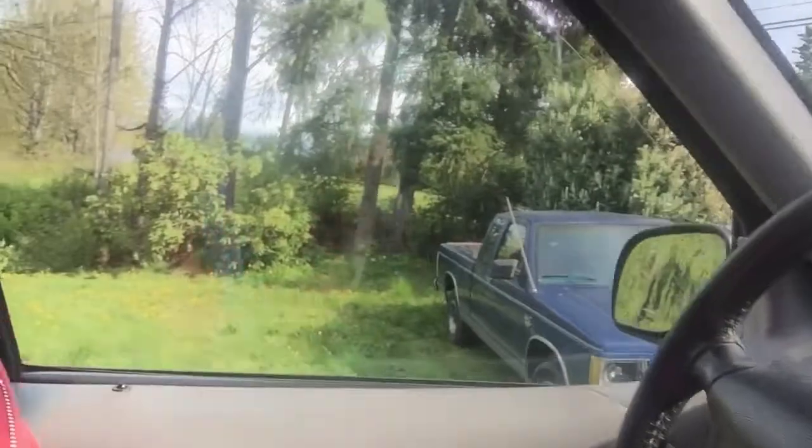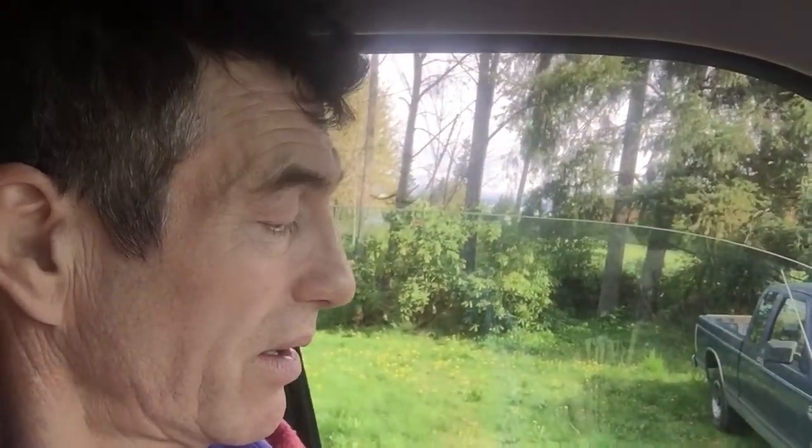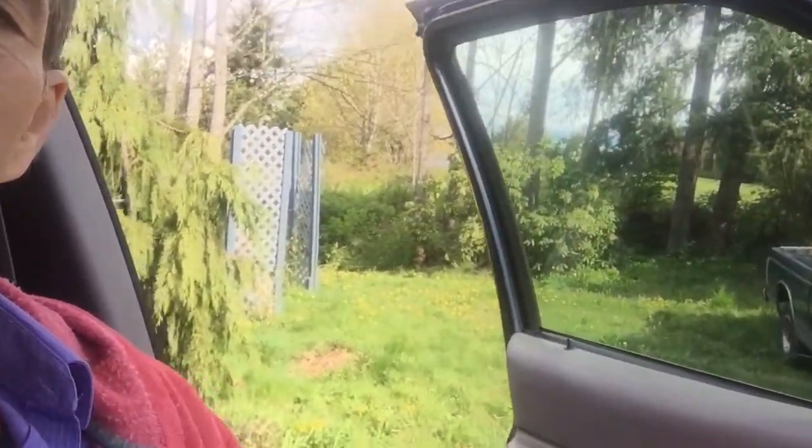I just tried the 1999 Explorer power windows when I just got in, started up and it didn't seem to work. But look — working now. All the windows are working. Let me try opening the door and see if it's going to work. Not working. So that means it's in that boot down there, because watch the door — partial of the way. See, it's in that boot.